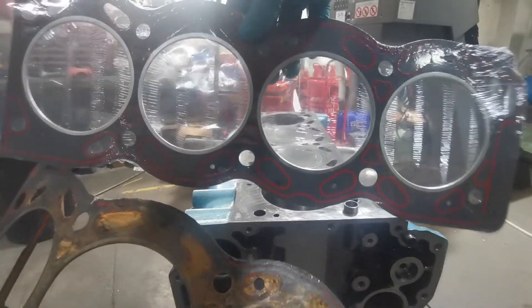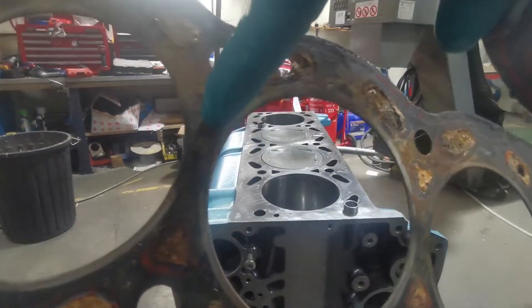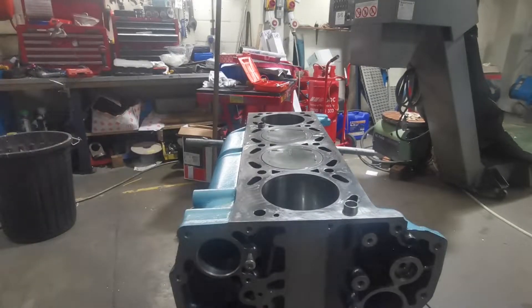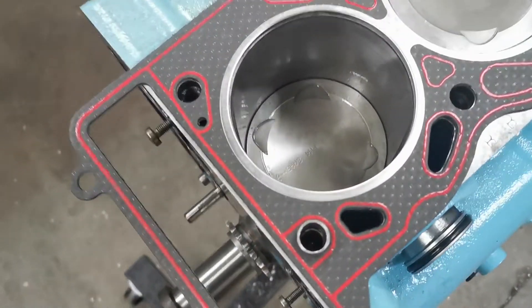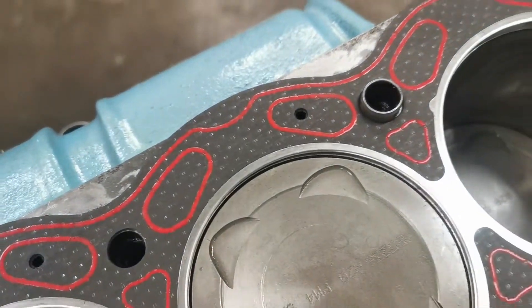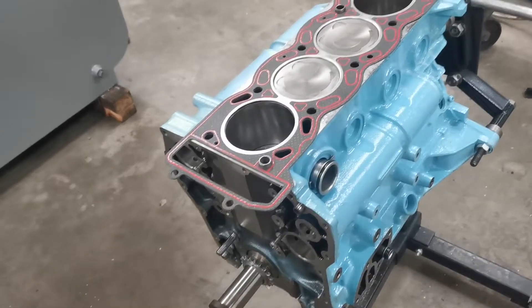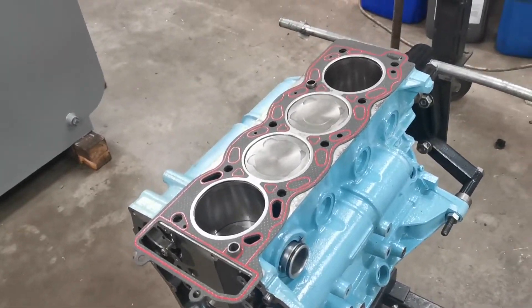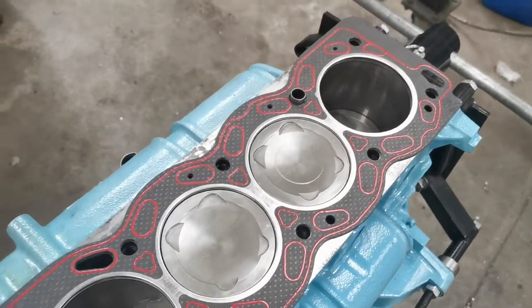In the comparison of the two you can see where it's blown on the rings — they're completely knackered. You need to take care when installing this because it's easy to snap. I've put the head gasket on with my new dowel and the original dowel. I'm just going to quickly test the pistons and crankshaft to make sure it all feels smooth before I put the top block on, because I don't want to put it on and have it feeling rough.